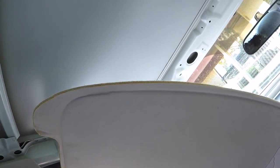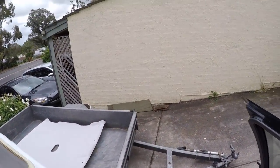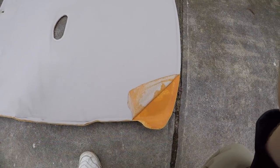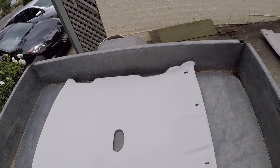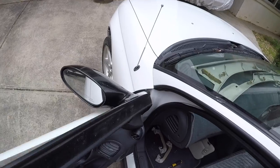To remove these boards out of the car, I like to position myself in the front seat with a blanket down over the console and the seats to protect them. I keep my hand as a buffer to not drag the board along the side B pillar or the door trim. You can see that you cannot reuse the old material because what makes it sag is the foam behind the material gets old and crumbly. If you were to spray glue on it now, you'd end up with a massive glue stain coming through. So today we're doing an exchange with one that we've got ready and prepared.